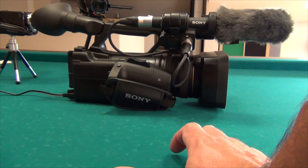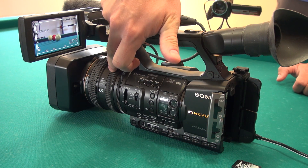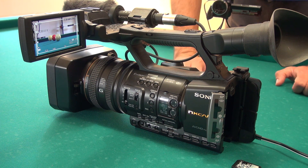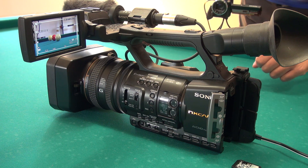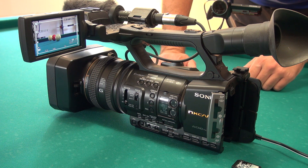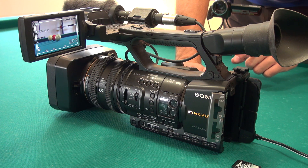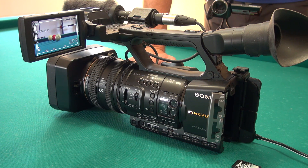But what have we added as a difference to the NX5? The body is mostly the same and we preserve the same lens. However, the sensor is different — we are sharing mainly the same chassis on the NX5, the PXW-Z100, and the NX3, but the sensor is different. On the NX5 it's a triple 1/3-inch sensor; on the Z100 it's a single 1/2.3-inch sensor for 4K. On the NX3 it's a triple 1/2.8-inch sensor, so it's slightly bigger than the NX5 and this camera behaves a bit better in low light.